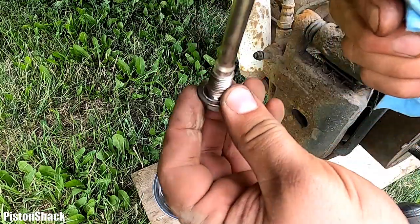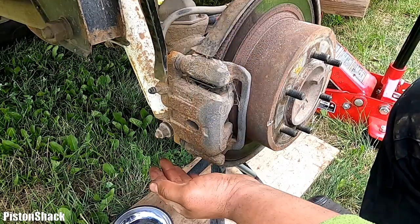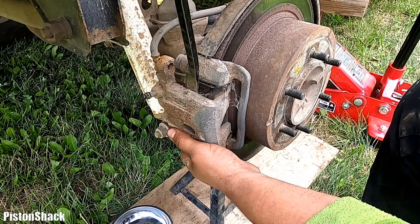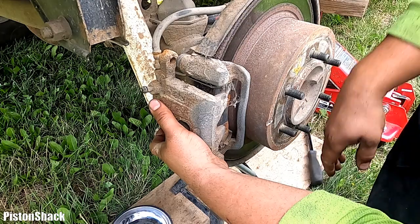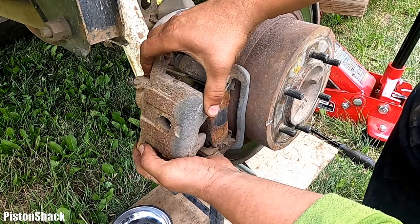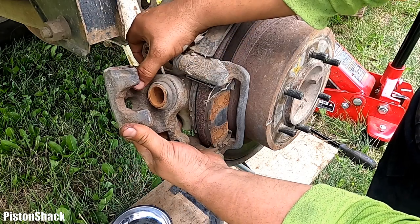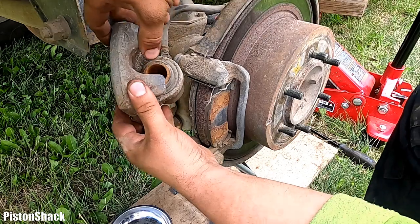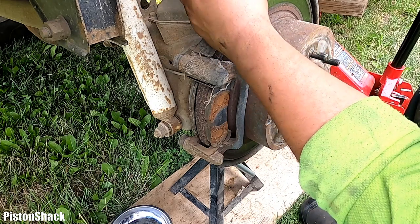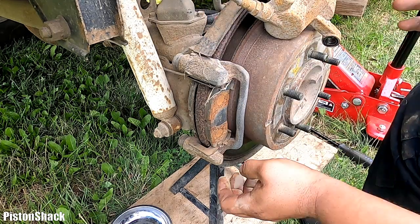Yeah, a special Mitsubishi Delica pin. Little pry bar. Let's pry the brake caliper up. There's a slot. Just carefully pry it up and wiggle it. Don't pull it too far. Don't put tension on the brake line. And like that, she came out. Some brake pad material here. Let's put it like that on top for now. It's not going anywhere. Like that. Beautiful.